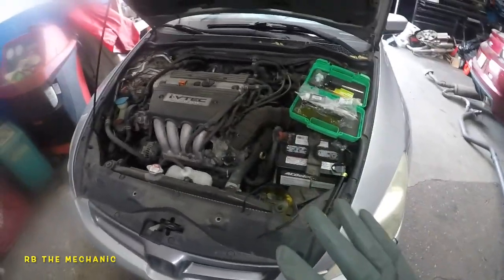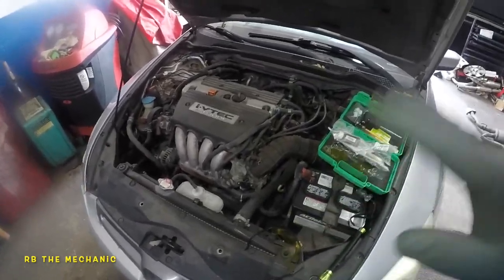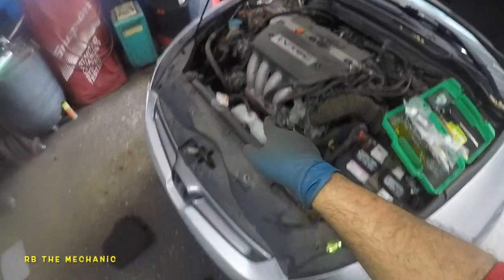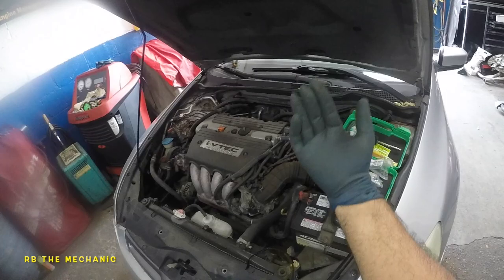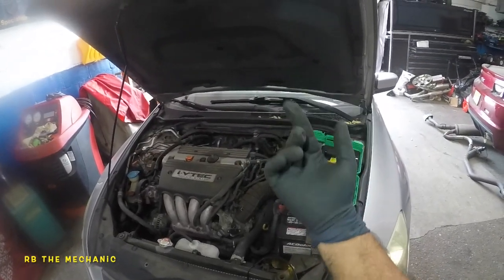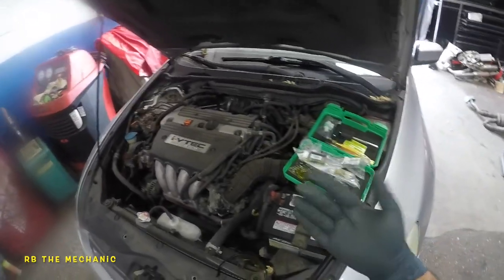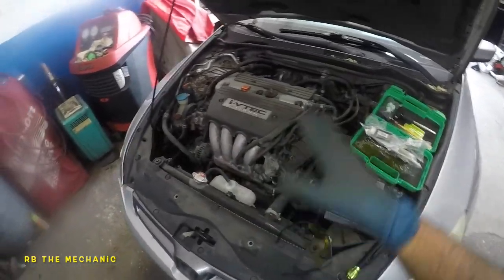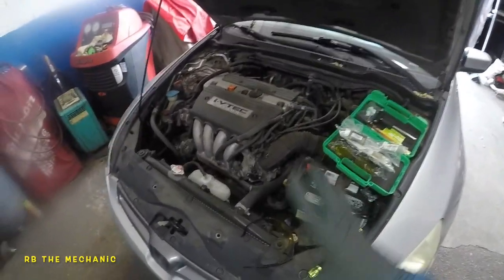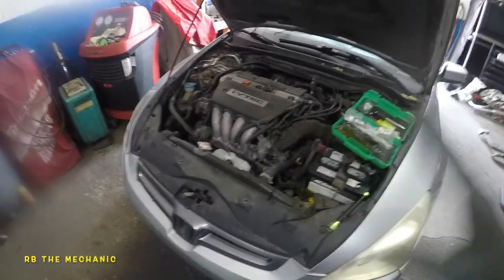This is my personal car — I know I have a small leak and I'm going to show you where to check and how to check. We're going to check all the lines, the seals, the compressor, and the front of the car. It's always a good idea to look first before you put UV dye in so you know everything is clean. I already have a small buildup because I've done this before and I'm waiting for the part.